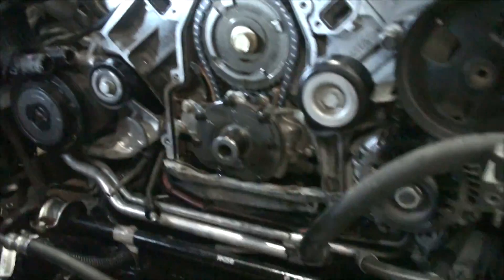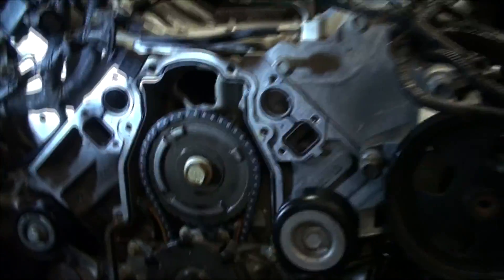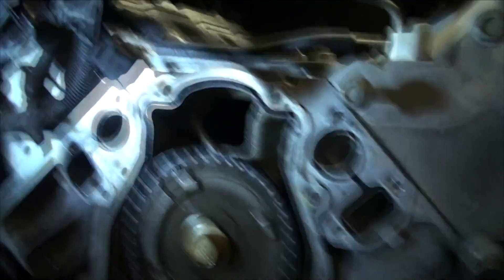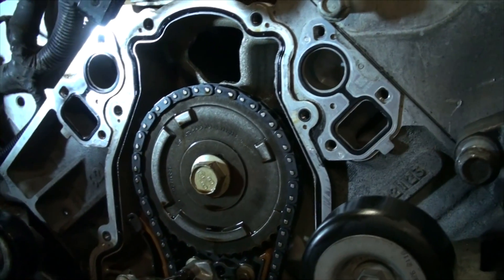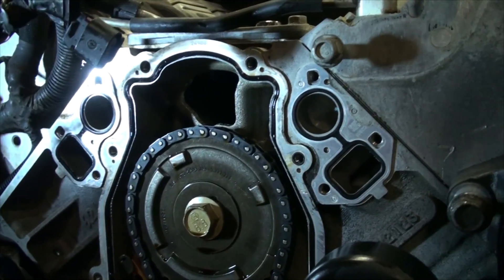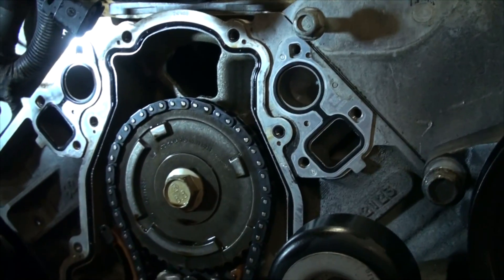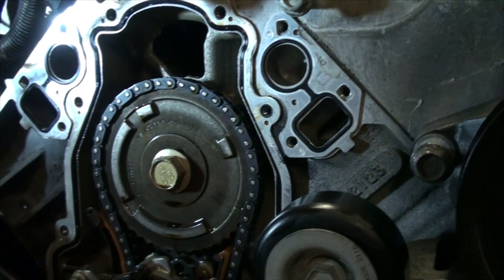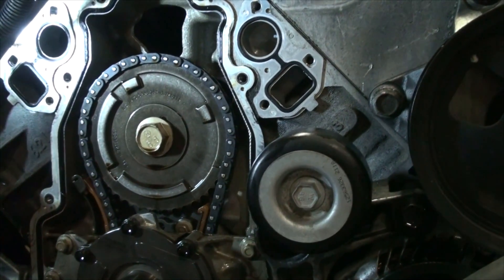There is your oil pump right there, and that is our cam and its drive gear. The front cover has a cam sensor — this pattern is read by the sensor and it tells the engine computer when the number one cylinder is on a combustion stroke. You have a 58x reluctor on the crankshaft to let the ignition know what's going on, but it doesn't know on its own whether it's on a compression or exhaust stroke. This is what tells it, and if it's not working you'll end up with a slow start or a no-start condition.